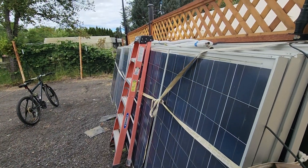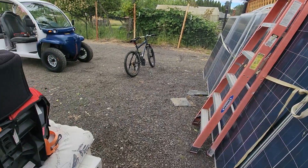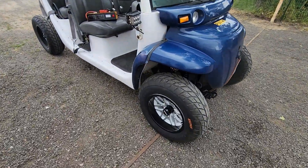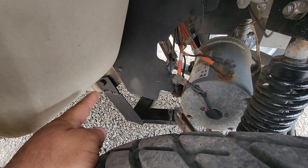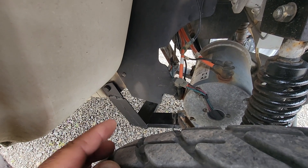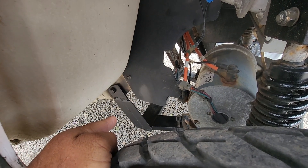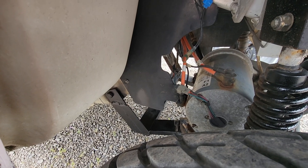That's another project for another day — the solar charging portion. But the LiFePO4 pack is great. The lift so far is great. You can see the cradle down here — I extended it four inches, brought it down and forward two inches, and that worked out really well. I just cut the old one and welded a new plate over the top of both.